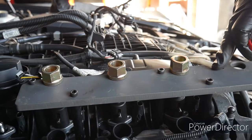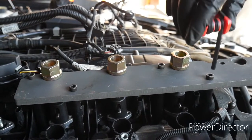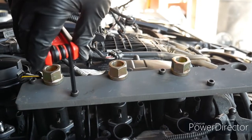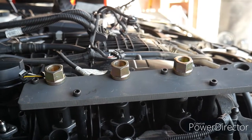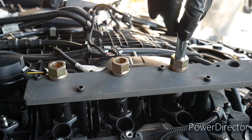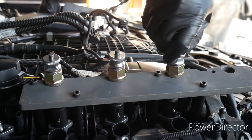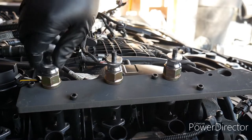These need to be tightened to 5 Newton meters. I don't have the correct socket for it, so I'm just going to be reasonably tight on these — just giving them a little wiggle and that's definitely 5 Newton meters. Now we're going to take these inserts and slide them into each of these, and those will thread onto the caps that we put onto each of the injectors, which is what actually pulls the injector out.